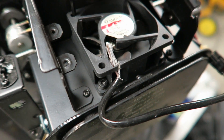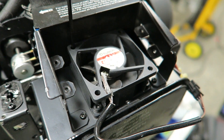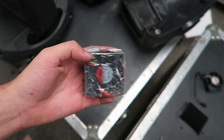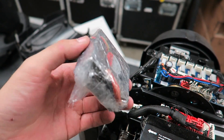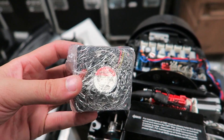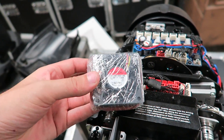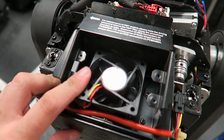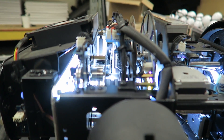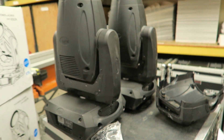I took the deflector off and using my 3mm Allen key I'll just remove all four screws, take this fan out, and replace it with a fresh one. Since I know this part goes bad a lot, I keep a small supply of fans on hand just for times like this. I'll actually end up billing the customer for a little bit more than the part's cost because they need this done ASAP — I'll throw this one in and then order a new one to keep in stock. New fan is in place. The camera battery died but I just finished going through all the tests and everything checks out, so we'll clean this up and consider this one fixture totally fixed. Two more to go.